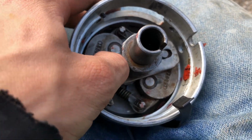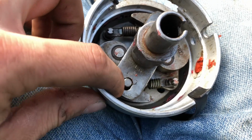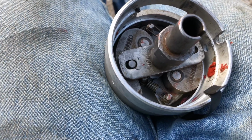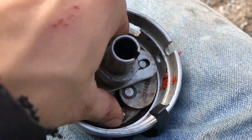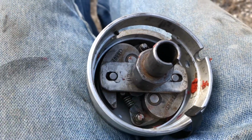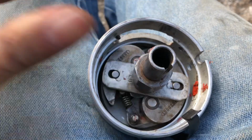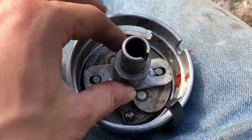But as you can see, the weights will sling out after RPM. I believe these springs started moving at 2,500 RPM, like 2,700 RPM, these springs started coming out. And I got all this stuff written down. This has been, oh geez, 4 years ago since I've done all this, and the car ran great. I'm just now starting to have problems and trying to diagnose that.